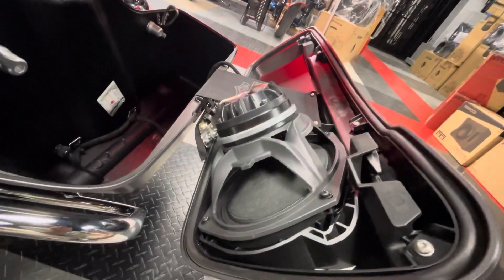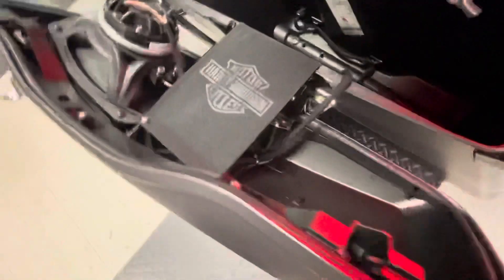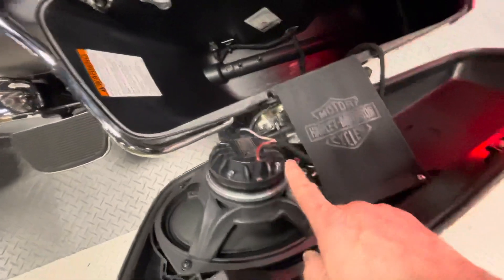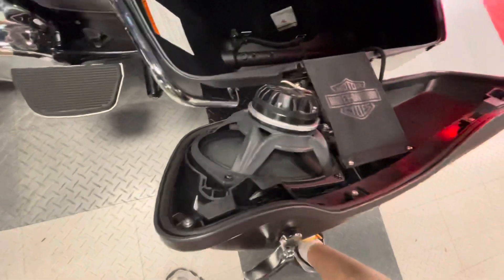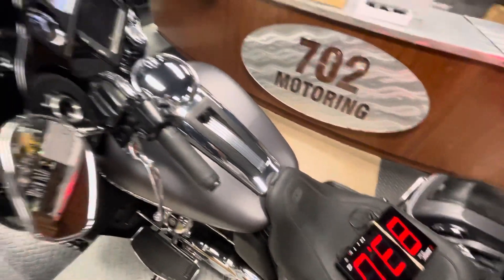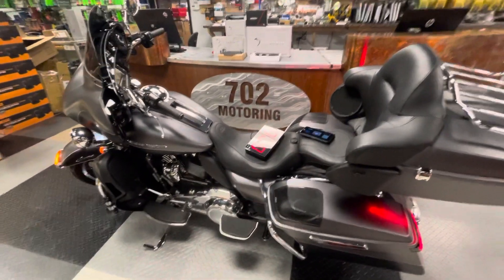In the saddlebag we have the Diamond Audio MP694 — this is a coaxial horn speaker with separate inputs for your horn and your mid, and there's a crossover that comes with this horn. We hide it underneath, you can't even see it. This is our installation, this is how we do it at 702 Motoring — nice ferrules, really out of the way, efficient, and working perfectly every single time. Quick disconnects, black stainless steel screws with washers — no shortcuts on the bikes, ever. We also have permission to use Tom McDonald's music — Tom, shout out to you, thank you very much. Much better than YouTube's royalty-free music.